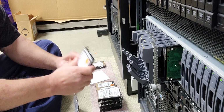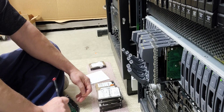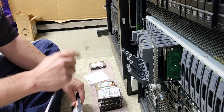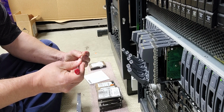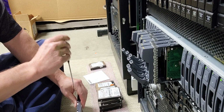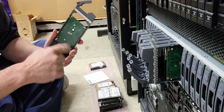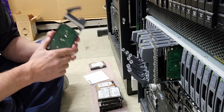Now, here's a trick. Can't say this out too loud, but you actually get the benefit of RAID and you get the power of HBA. Let me explain. When you have an operating system that's using, let's say, ZFS, TrueNAS kind of environments and so on, you have a little bit of a variable in the equation. It's software. That's the variable. Your management, and how it communicates, is all in the software. But RAID controllers, on the other hand, work in the hardware. They're on the logic of the controller card below the operating system. So you can get the best of both worlds, actually.